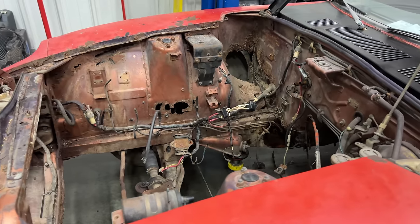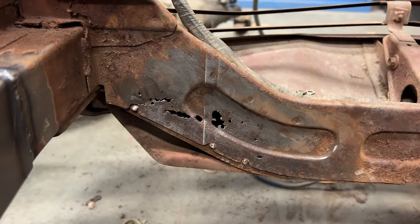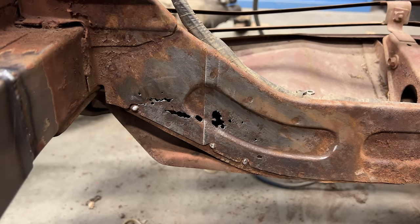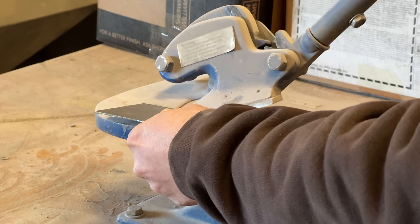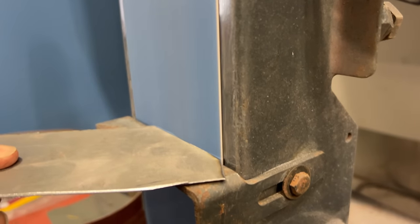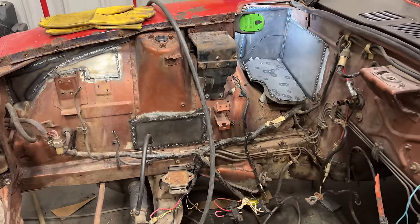Now that the engine has been pulled out we get a good look at all the holes on the passenger side of the car. The driver's side of the engine compartment looks a whole lot better. I'm not building this car for restoration, so I'm just going to put patches over the holes to keep the car together and keep the structure. Best thing to do is take pieces of cardboard, draw out your patterns, go cut those patterns out of sheet metal, use a sander or grinder to get the shape perfect, then tack on your patch. After you have welded the perimeter you will have ensured that the car will last another 20 or 30 years.